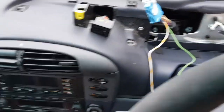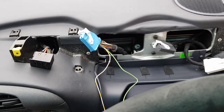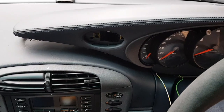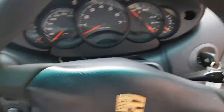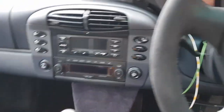So now what I've got to do is just rest the instruments back on, reconnect the connectors on the back of the instruments, and then I can reconnect the battery and start the car. I've reconnected the three connectors at the back, rested the instruments in place. Key in position 1, voltmeter now set onto volts. I'm going to reconnect the battery.